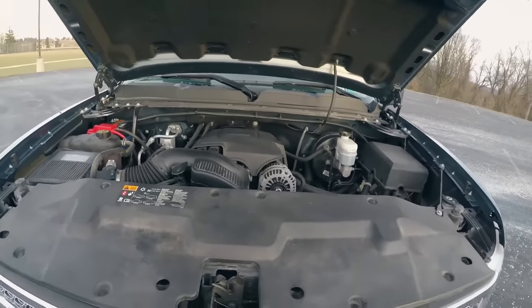That install cost is a lot more, and we actually don't even do them here. Custom Offsets uses Offsets Garage to do all of our installs and they basically won't touch body lifts because we don't recommend them. We don't think they're super safe on a lot of the newer trucks and they're just really difficult to install — people don't want to pay the labor cost because you literally have to separate the body of your truck from the frame. If you do it yourself you might save quite a bit of money, but it takes a lot of time. On an older vehicle it's not quite as hard because you have fewer electrical components and hoses to worry about stretching. It is kind of a benefit on older vehicles because it makes motor swaps easier — it gives you more space in the engine bay by pulling everything away from where the engine is bolted in on the engine mounts connected to the frame.